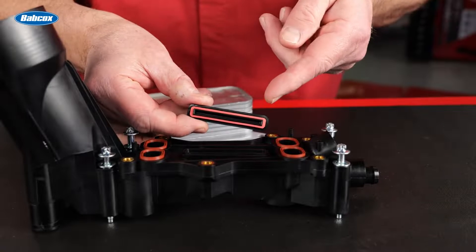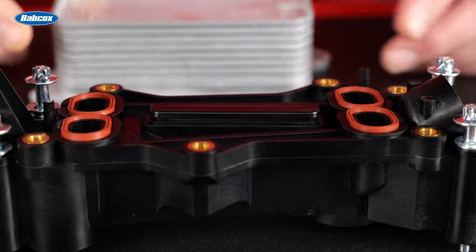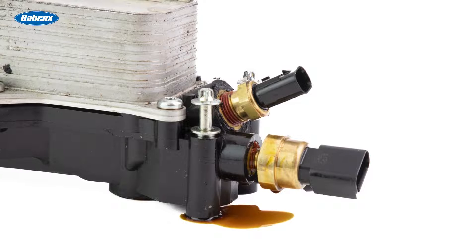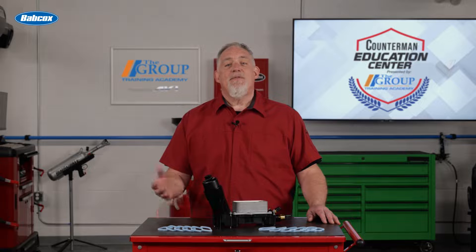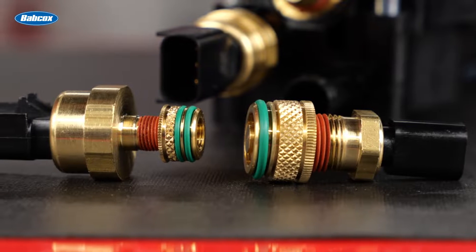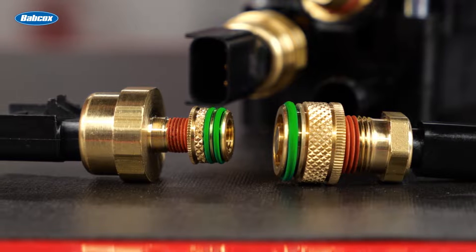There's also a core plug right on top of the unit below the heat exchanger. This is another place where Standard uses a seal before ultrasonically welding the core plug into place. You've probably seen these leak around the sensors as well. The problem isn't actually with the sensors, but with how the brass inserts for the sensors are pressed into the housing itself. After thousands of heat cycles, oil can begin to leak between the brass insert and the housing. To correct this problem, Standard revised the knurling of the brass insert and included O-rings on them — one O-ring on the temperature sensors and two O-rings on the oil pressure sensors where the leaks are more common.